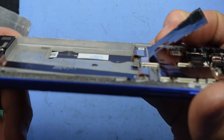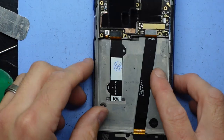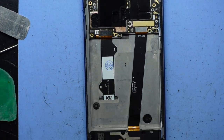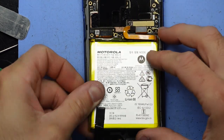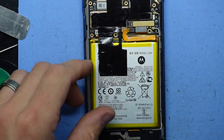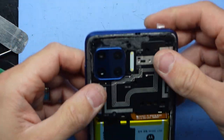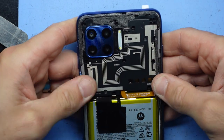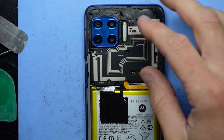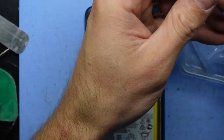Next up from here I want to work this way. There's still a bit of sticky tackiness to it on there, so we're good to put the battery back in. You may have to straighten the battery back up before you put it back in, so that's what I'm just going to do now — just requires a little bit of bending. Line that up, drop it in, connect it back up once more, fold this back down, and now we're putting the shield back over the top. Next up after this we'll be putting the back cover back on, or gluing the back cover back on — you can replace the adhesive. I'm just going to go over with some more B7000 frame adhesive.